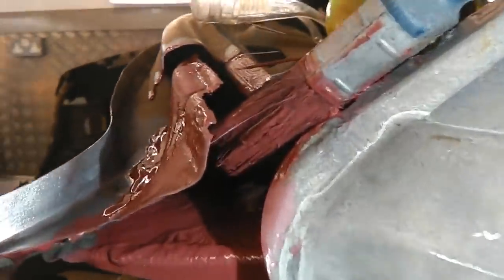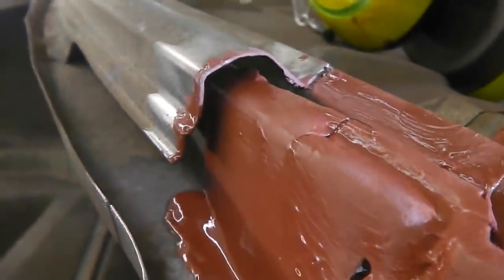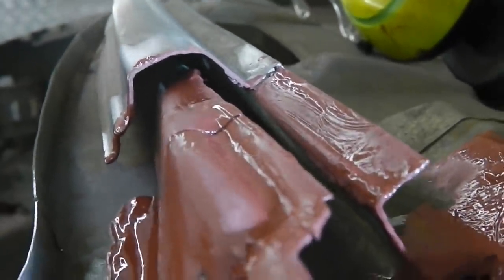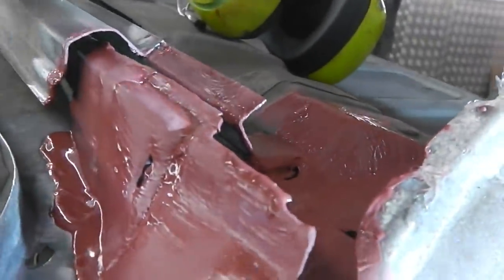But for now we'll just get this welded in place, and then we must remember to inject the paint inside right the way down here using the lance and a pressurised gun, and we'll draw the tube through so that that cavity there is well covered, and again on this side of the baffle. You can just see the baffle bridges underneath, the sort of bridge shape the baffle goes. So we'll make sure that we do put plenty of rust prevention into that area.